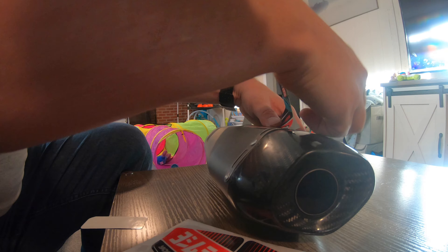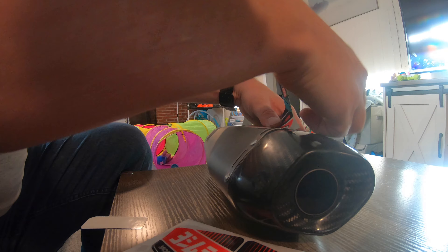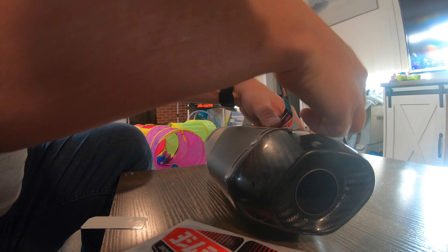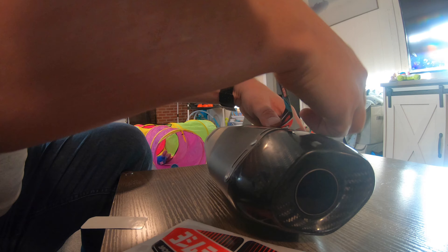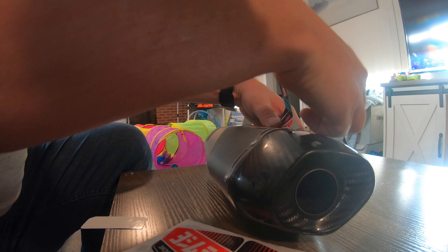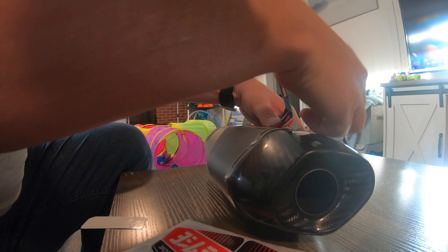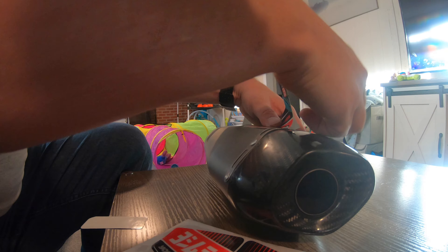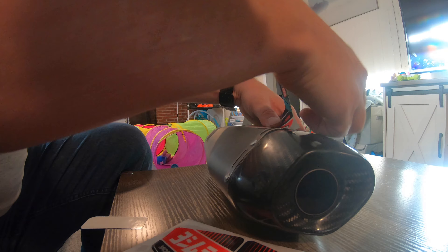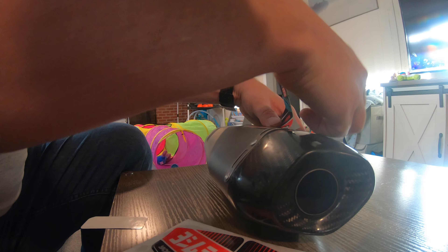A big reason I wanted daddy Dio here — he's good at this stuff, factory mechanic and all. I've honestly never worked with rivets before. I actually bought this Harbor Freight hand riveter because I've never done them. Dad was showing me how you punch out the middles, we have our punches, then drill them out, then punch them again to make sure the rivet is all the way out. It's all in the instructions from Yoshimura, but it's always nice to actually see it in action. So we've got this one all out and now I'm going to work the end cap off.